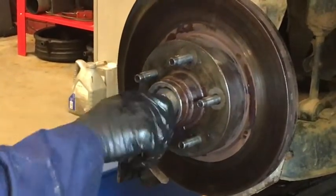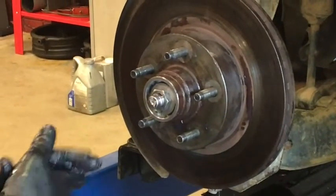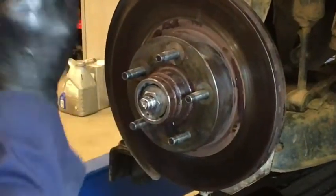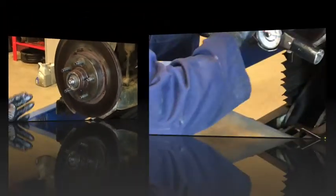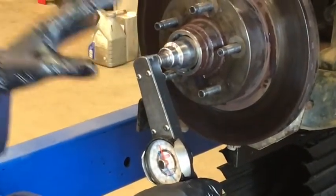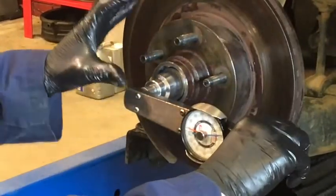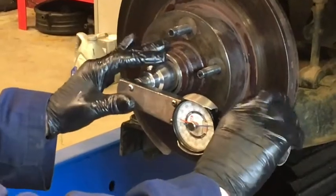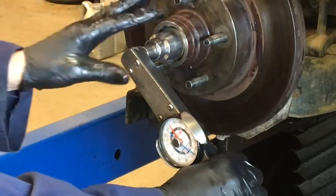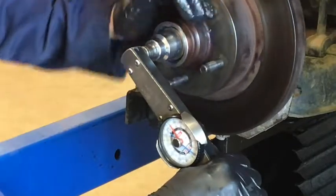Now there are a couple of ways of adjusting these. Every manual is going to give you a specified amount of torque to put on them — it's not really high. On these types of bearings we just need to take the play up in the bearing a tiny bit more. As a rule of thumb, every manual will have a slightly different spec requirement, but generally you just want to take the play up and add a little bit of pressure. So we're going to put about 100 to 120 inch-pounds of torque initially on that nut. This is not the final torque — this is just to seat everything, and we're going to rotate that rotor to make sure the bearing is well set.